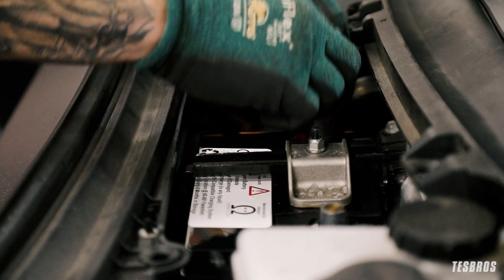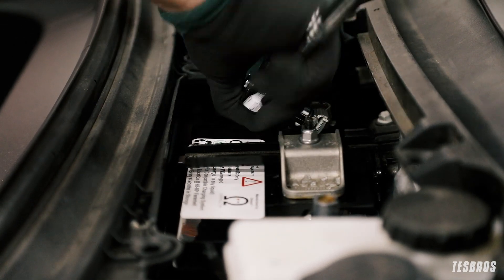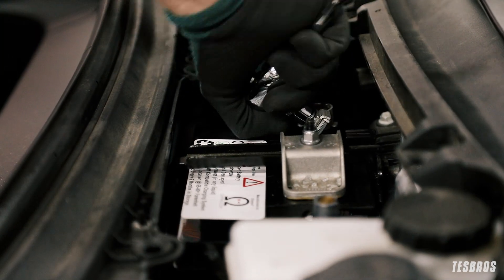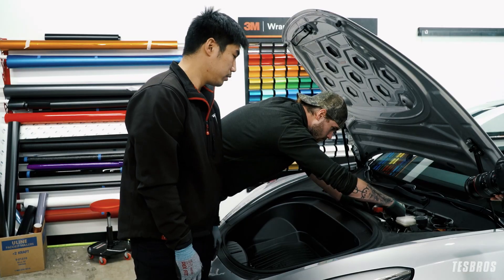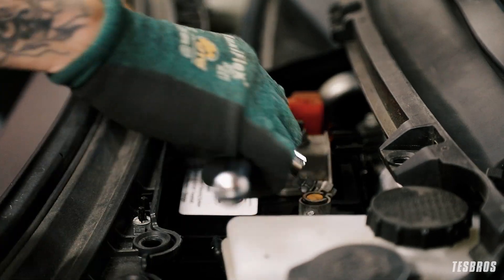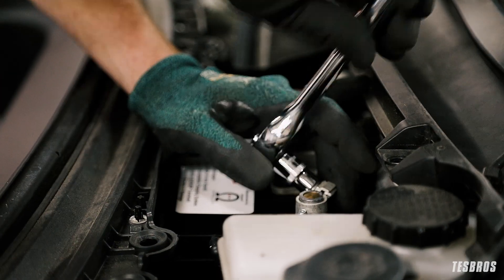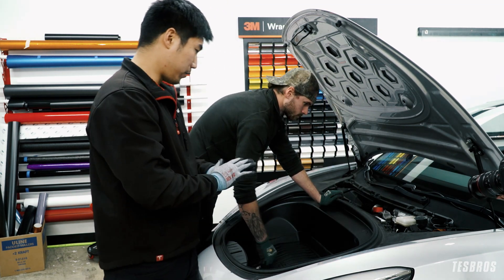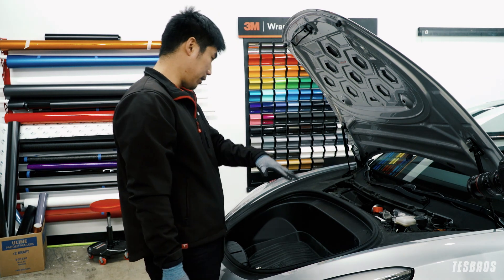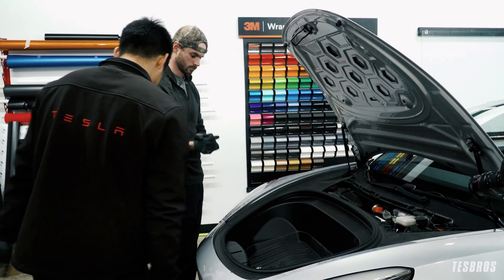The order of steps when connecting is the reverse — you're going to do the positive first and then the negative. Go ahead and connect the positive, same thing — just don't over-tighten; once it's grasping it should be good to go. You could already hear the car start whirring and making sounds once that negative was connected. So we're already bringing 12-volt power to the car. That's pretty much it — I already heard the sound so I know it's good, and we're going to go ahead and put it all back together.